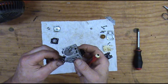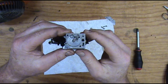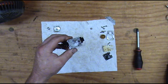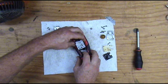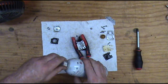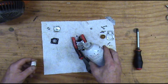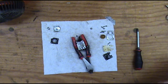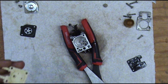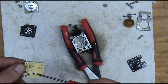We're going to fix the problem and not create any new ones. One thing I do like to do with these carburetors is pour a little Seafoam into that metering area and let it sit while I'm going to gather up my parts — it's just another level of cleaning. We're going to set the carburetor like that and pour a little bit of Seafoam right there and let that sit. Don't use any really high pressure directly on any of these holes. You can hear me blowing the carburetor off, but I'm just blowing it off — I'm not holding the nozzle right up to these holes.